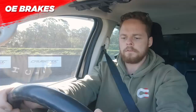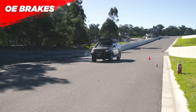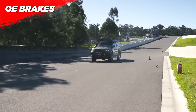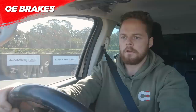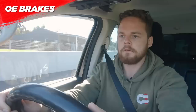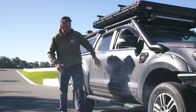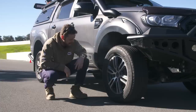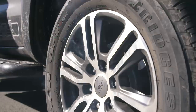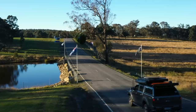On tests two and three we recorded a similar stopping distance and pedal effort, but now is when brake fade starts to set in. After four runs you can really see we're seriously losing braking performance and they're starting to smoke — the brakes are heating up and aren't working as well because it's harder for them to dissipate all that heat. On test five I can really start to feel the pedal sinking to the floor. After a few tests the brakes are really starting to fade and get hot. The distance wasn't too different, but the force I had to apply to the pedal to get it to stop was greater.